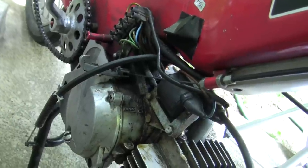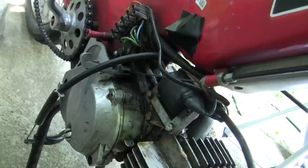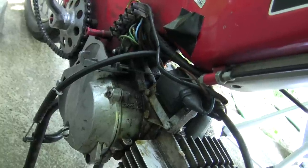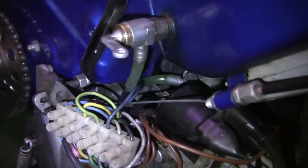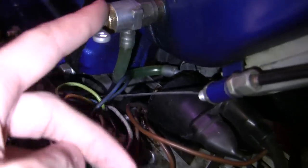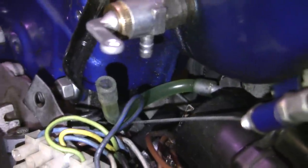Next step is to shut your fuel off and then disconnect your fuel line. Since I was running an external tank on this bike, I'll show you on another one of mine. With your fuel switched to off — this might not actually be the right position; I believe this petcock is installed upside down — but anywho, that's what fuel off is for me. Go ahead and pull your fuel line off. It might require some wiggling, maybe a little bit with a screwdriver if your fuel line's a little bit older.